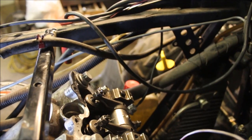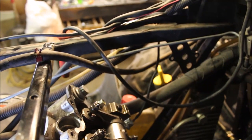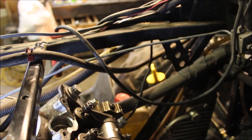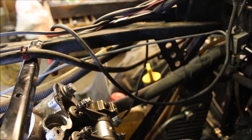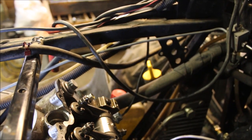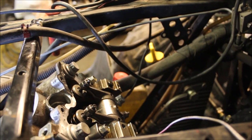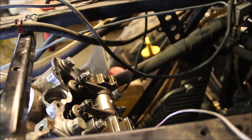You get a manual, it says everything in there. I can kind of rattle it off, but I don't even remember it by heart. I think it starts out with 22 foot-pounds, then up to 52, then you back it off two turns, then you torque it to 11 foot-pounds, then it's a quarter turn on each bolt, another quarter turn on each bolt. So you're driving it in, you're backing it off. The reason behind that is the bolts do stretch, so you want to make sure they're in tight. I used to work at an engine plant. We did the same thing with brand new engines. So I'm going to pull this head off and show you what I got.